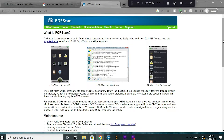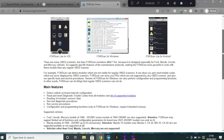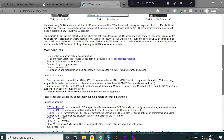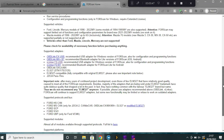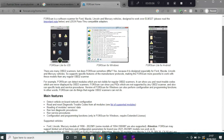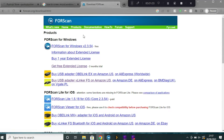On the FORScan site you can see some information on what FORScan actually is. Primarily it was a diagnostic tool but it also works as a programming tool for Ford vehicles as well as Mazda and some American brands. As you scroll down the home page shows you the main features of the software as well as some of the supported adapters you'll need to connect your laptop or mobile device to your car's OBD2 socket — I'll leave a link to the one I purchased in the description. To download FORScan, click on the products tab at the top of the page, and right at the top is FORScan for Windows, which I'm going to be using.